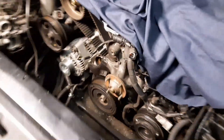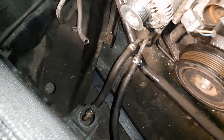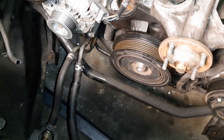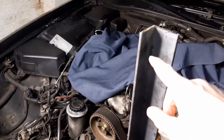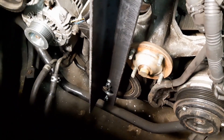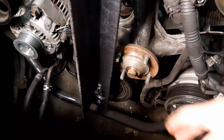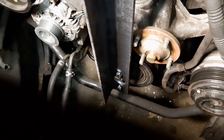Back at the car. There seems to be a small problem with my tool I just made - it's running into this section of the bodywork of the car. So I have to make a quick solution. Maybe I can bolt it in and hold it by hand in its usual position - maybe that will work too. And what do you know, it will fit in there standing up straight. So I can hold the tool with my left hand and pull the torque wrench with my right hand. I'll screw in those bolts next - there must be some thread in there, but I can't really feel it. There's some dampening material because it's a harmonic damper too - some rubber material in there. Important thing is that the entire thing is as far in as possible.